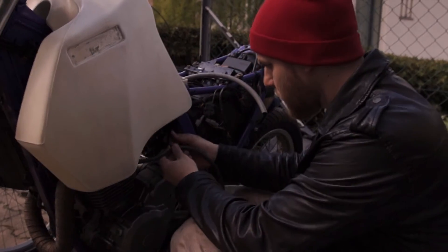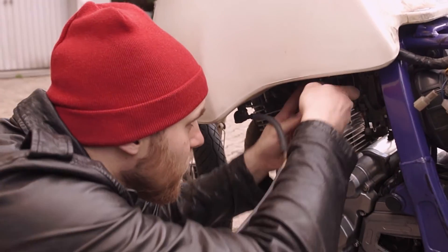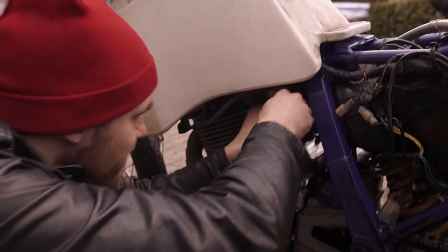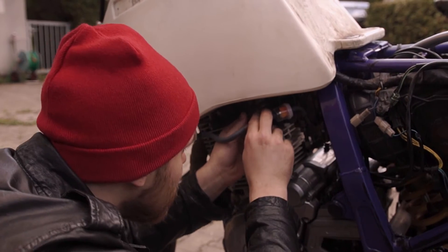Because the old fuel lines were literally rotting away I had to fit new ones. Those are green-covered for longer wear, and instead of the tiny filter in the carburetor inlet I fitted a decent fuel filter right where it's more or less shaded.